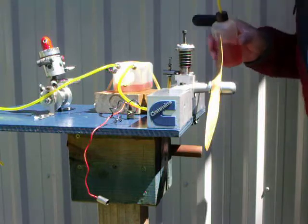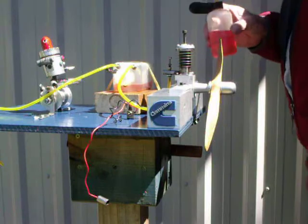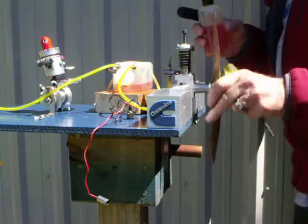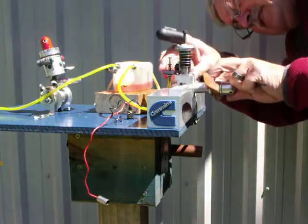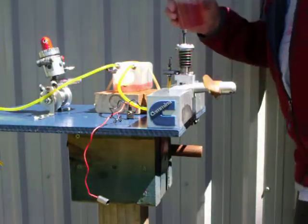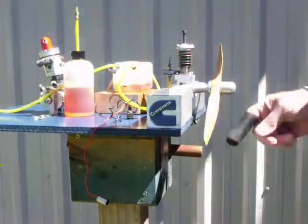So compression's good. Compression screw, contra piston is very tight. I could take it apart, maybe lap that contra piston just a little bit better. But I've gotten onto it now. I just have to keep the compression down when I first start it up, and then it'll build.